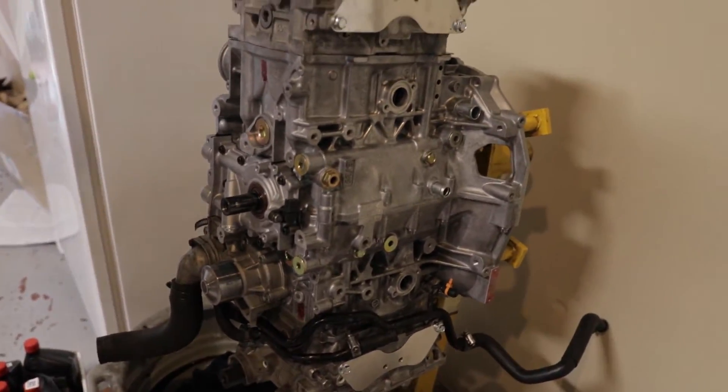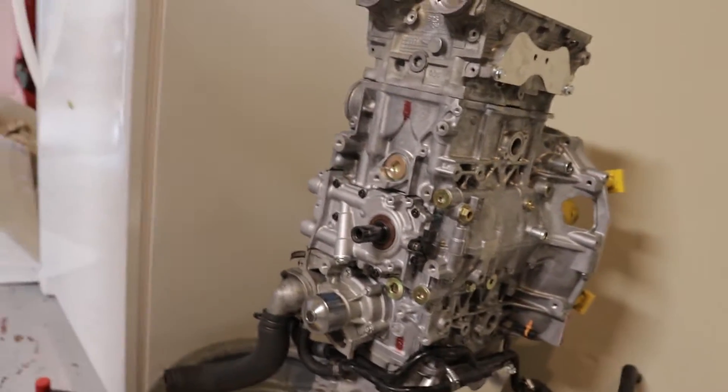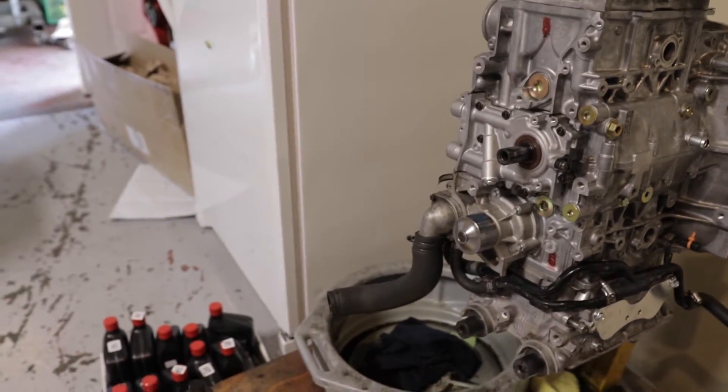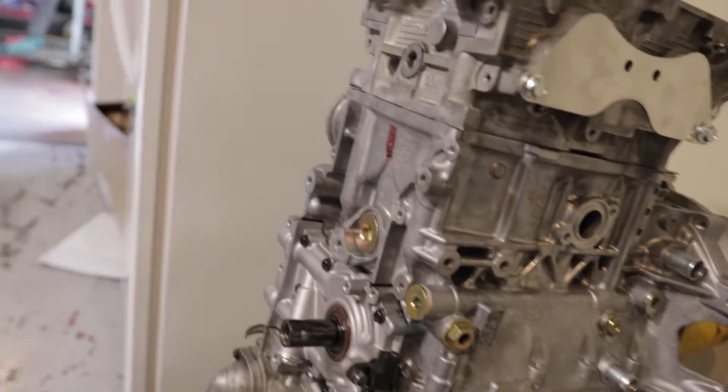As you can see, this is definitely not a stock motor — this is my built motor. It came out of this car. Just so you guys know what happened: the motor was totally fine, I just sent it out to get redone — new bearings, new piston rings, as well as to get bored out for larger head studs. That way I can definitely hold down the power. It took a while because when they pinned the main bearings, it was about a month behind on that.